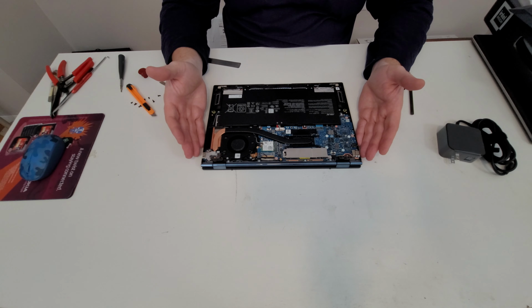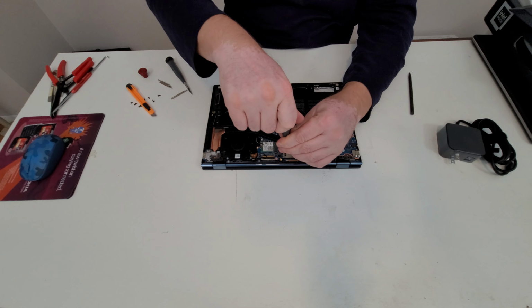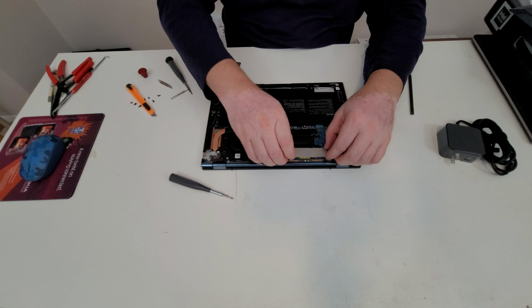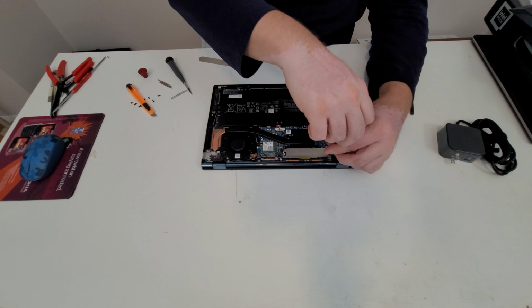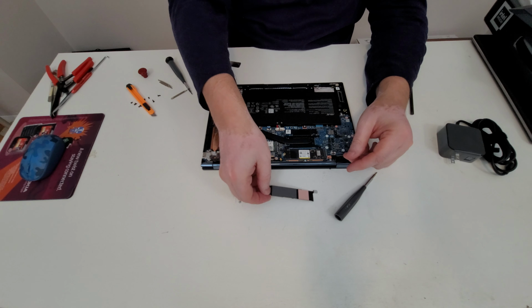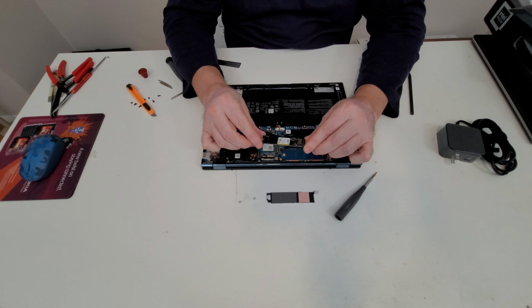And not much else. We do have a hard drive that can be upgraded, pulled out, or recovered. I do recommend, if you have a computer with a solid state drive, that you remove the encryption on a drive, unless you know how to handle the keys. Microsoft account will store your keys. So if you're planning to use Microsoft account, not a problem. If you don't plan to use Microsoft account, definitely make sure that the key is stored.